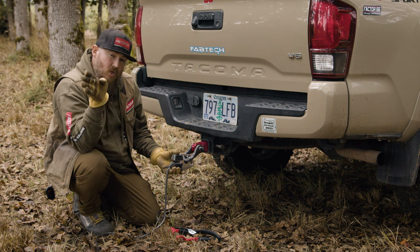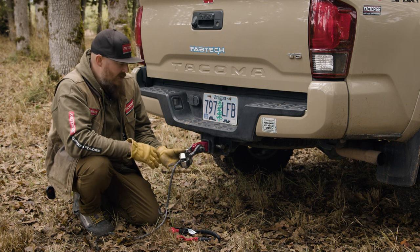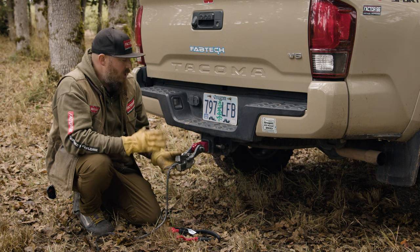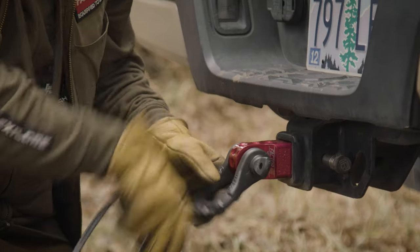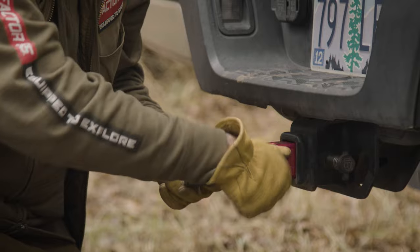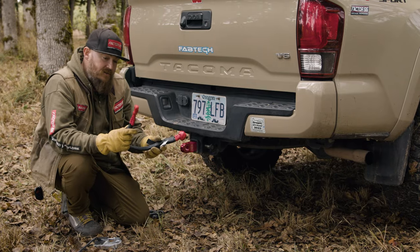In this scenario, our tree is a little to the passenger side of the truck, meaning we'd be pulling on the shackle at an angle. Not necessarily a huge deal given the size and weight of our vehicle, but for safety purposes we'll show another method. You can take the hook off the full-size shackle, remove the three-quarter screw pin shackle, and simply use a soft shackle instead.